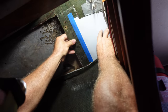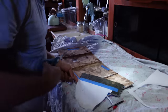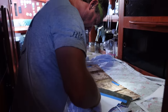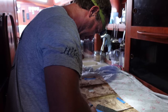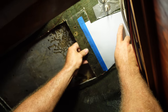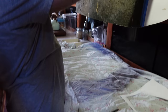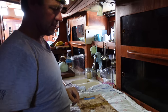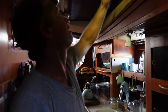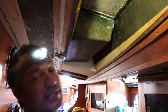He's very clever, my husband. After he scribed it, he's just cut it out and now he's just checking. I'm going to try and get a little bit of a gap around it — make it so it's not too tight, about three mil on either side — and I'll just fill that with epoxy. So I'm just using this piece I cut out as my template to mark out on the new sheet. I'm going to put a bolt through here and a bolt through there, epoxy it and tighten it up, then fiberglass all around the seam and tidy it all up.